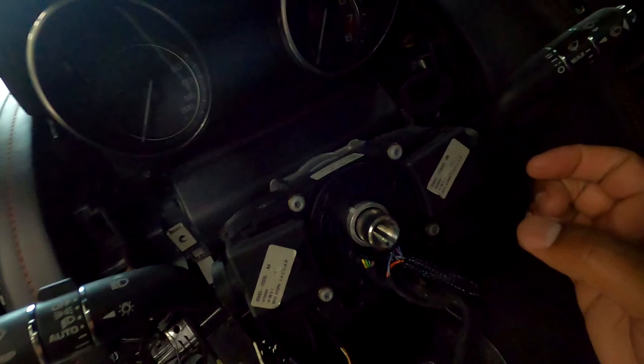All right. Then you've got another screw on the left side panel. So basically, when you open the door on the left side of that whole console, that little side panel comes off. You've got to pop that off. Inside of there, there's a screw right on the side. You'll be able to look right up in there and see a screw kind of on the front part, toward the driver part. You pull that screw out, and all of that should release the panel.